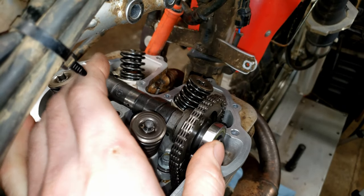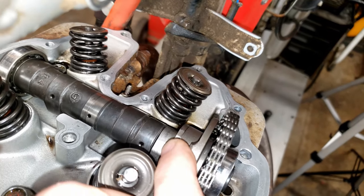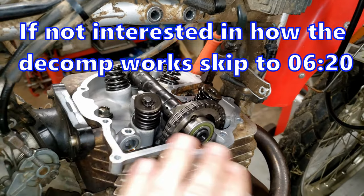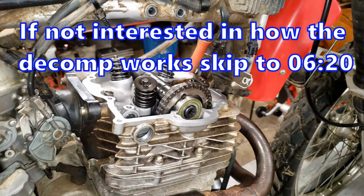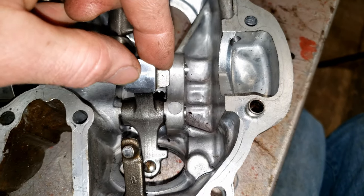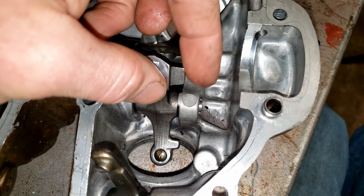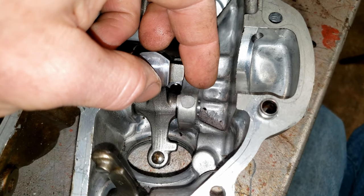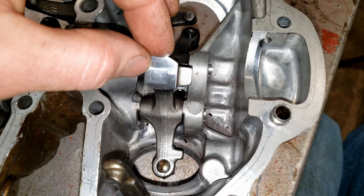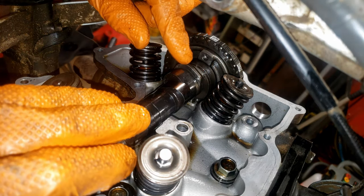Based on Dave's complaint I decided to pop the camshaft out, figuring there would be an obvious problem with the decompression system, which led to the broken rocker — but I didn't really find any issues. Here's the rocker arm that Dave replaced; you can see the decompression tang is broken off. It should look like the one he replaced it with. When he put the new rocker in he got all that noise. It's possible he just misadjusted the valves, because if you look at this rocker face it does look kind of hammered for a brand new rocker.